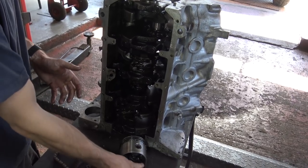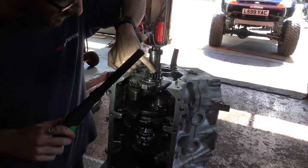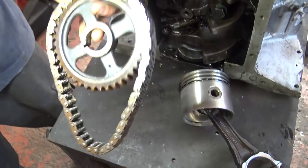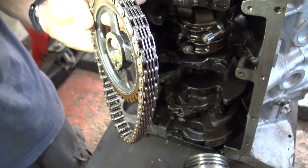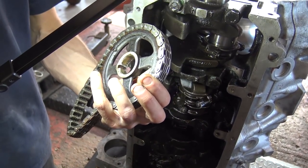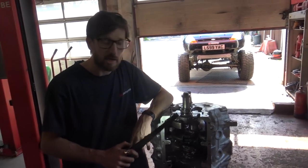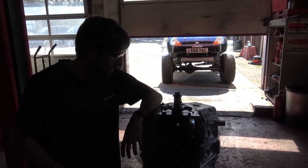Not very impressive. The other thing we noticed was the wear on the timing chain sprocket - judging by the colour of it, he decided to reuse the original one, why you would do that I have no idea. The customer is now having a fresh engine built up by us and is looking forward to getting his second MG on the road - he's got a GT and this one is a Roadster.